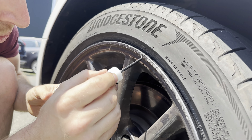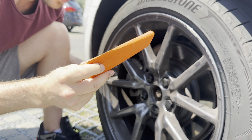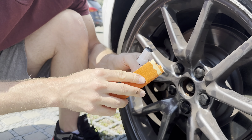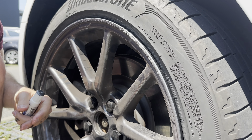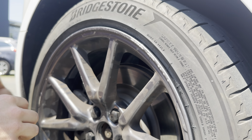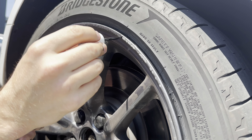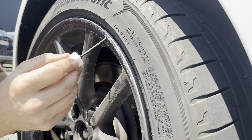I decided to show you this easy, fast, at-home fix — it's super fast and relatively cheap. Before you apply the paint, if you have a deeper scratch, you can use sandpaper — the tiniest grit — and very gently smooth out that area to make it even. Once it's even, you go over it with the paint. Be careful not to scratch the other painted parts. This is useful if the aluminum is exposed, and also to protect that area when you change tires next time or go to a service.